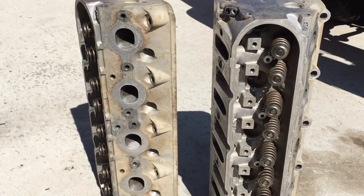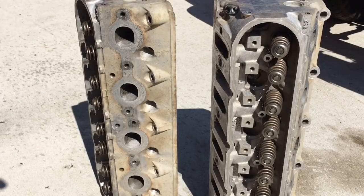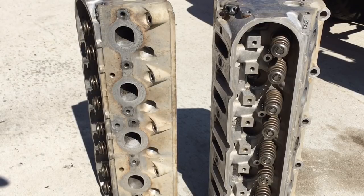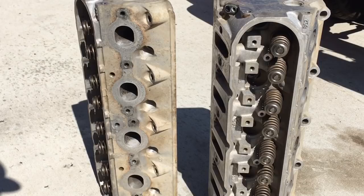Here are the 862s off of the 2000 4.8. I just wanted to show you guys how the Easy Off Oven Cleaner and the pressure washer at the car wash basically got all the carbon out of the exhaust ports — probably 60 to 70% out of the intake ports. Because there's no spark plugs in these, I couldn't fill the ports with the cleaner like I could on the exhaust side. Down in the valley, where the valve cover seals, it was super dark and built up with burnt-on engine oil, and it all came out.